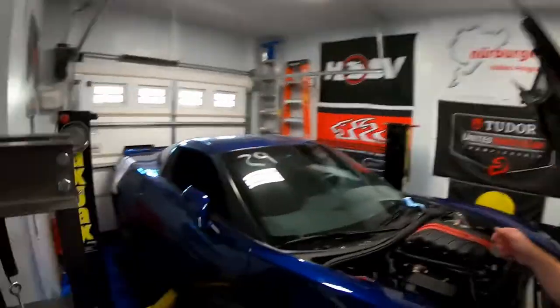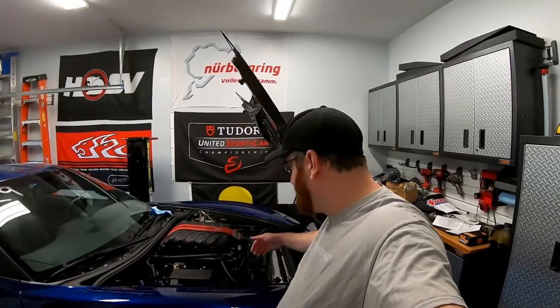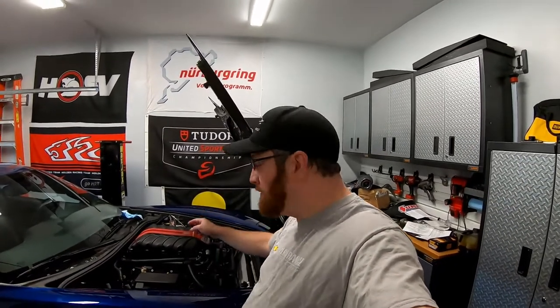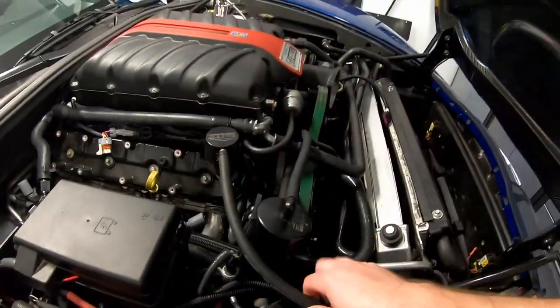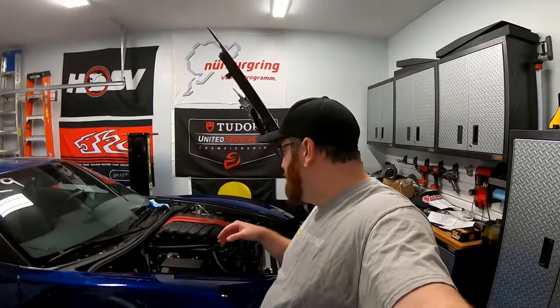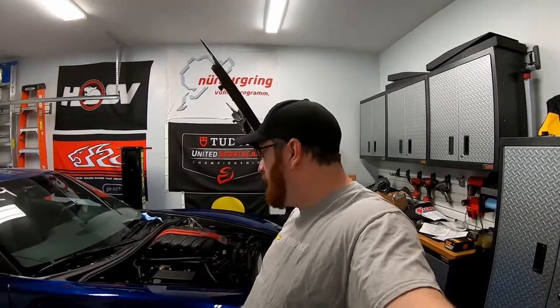The third thing I did was add a check valve between the supercharger and the catch can on the inlet, so no motor oil would get sucked into the catch can and go back into the supercharger. Then we eventually added an Elite Engineering clean-side catch can. But when we were swapping the 102mm throttle body between both cars, I still found oil inside the supercharger — so we still had a ventilation problem.